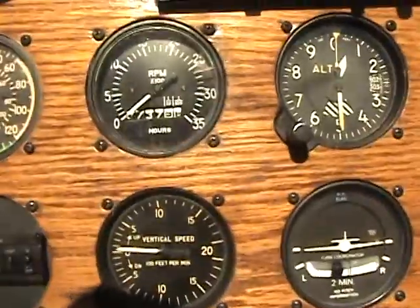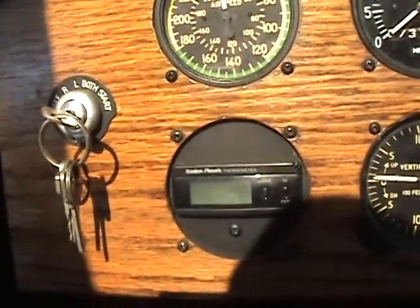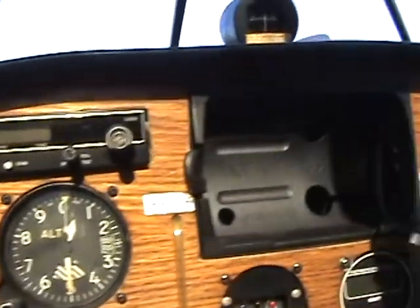Just brakes on the one side. The airspeed indicator — I'm told by an RV flying next to me, and it felt right with the way the airplane flew — it's about 10 miles an hour fast. I don't know if it needs to be worked on or if I don't have the pitot tube directly aligned.